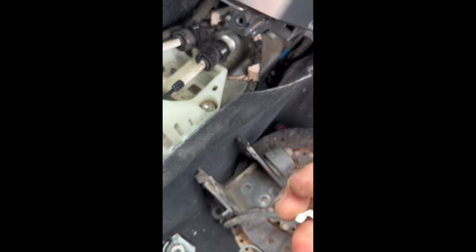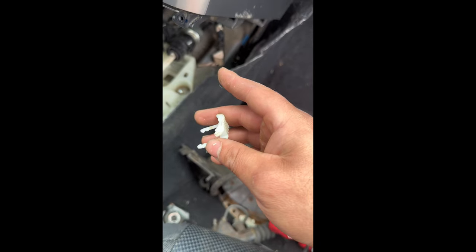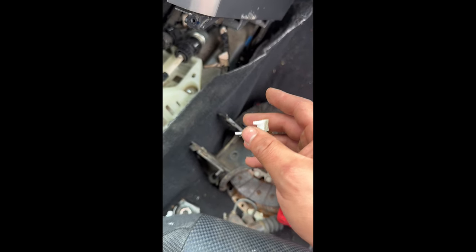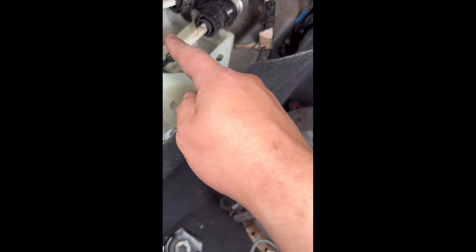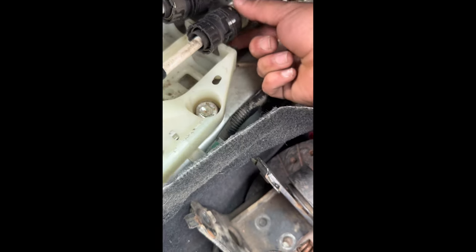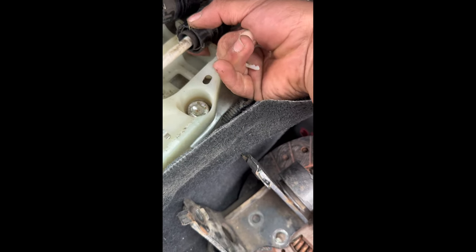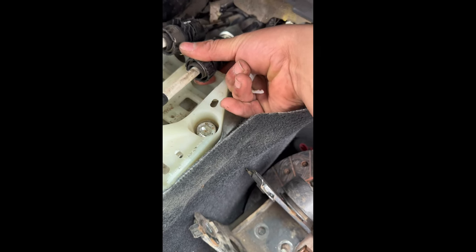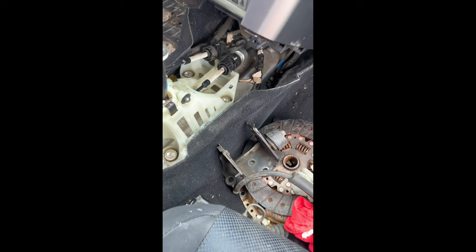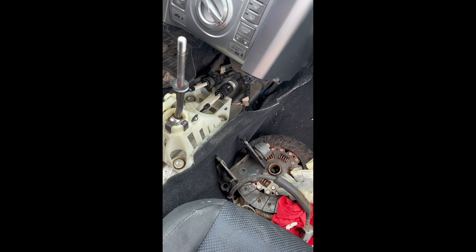The clip will spread out like this - you just got to open it up and push it down, and that removes the locking portion. The cables themselves have a white locking tab on them - similar to what you'd see on fuel lines or evap hoses. Just push it out. The way it works is it sits in the middle, but you basically twist it to give yourself enough room to wiggle it back and forth and pull it out. Once you mess with it yourself you'll see what I'm talking about.